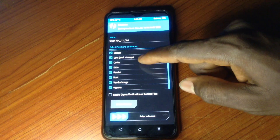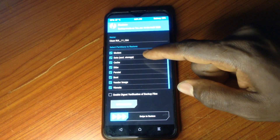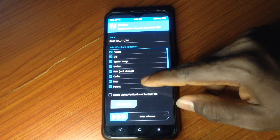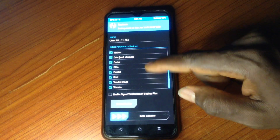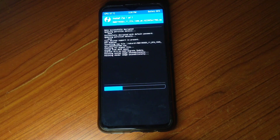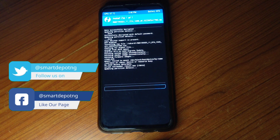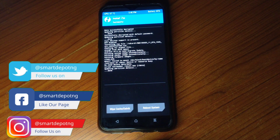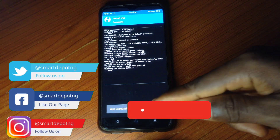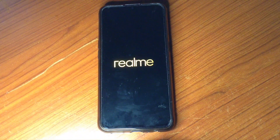That's very, very terrible. As you can see, there are two persist partitions now — one on top, one at the bottom. One restored, one didn't restore. The persist partition is the most important partition and very unique to your device. So you have to make sure you back up both of them — the persist image and the persist data.